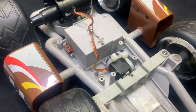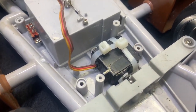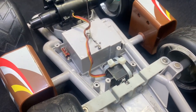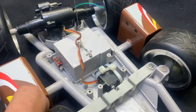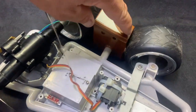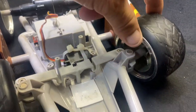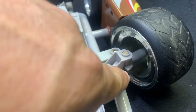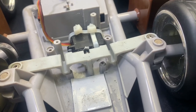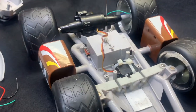I have done a modification on the steering servo. It's not the best modification because it is a different mounting process, so I've had to run a couple of zip ties. I don't want to modify anything on the main body — underneath, if need be, that's okay. It's only two zip ties crossed over. I've got a nice steering servo in there. There's not much turn on this, only because the tyres are borderline touching on these side guards. I could get a bit more turn by trimming down these bump stops right here — as you can see, when it stops there, it gives me that limited turn.